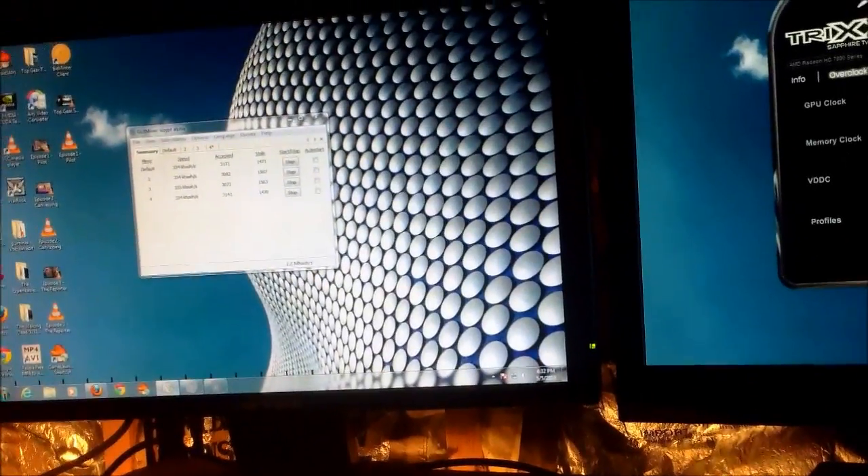I'm running Litecoin mining at this time, and I'm running just under three Litecoins a day — about $10 per day on this rig. Minus power, which is $1.50, so I'm netting about $9.50 on this rig per day. I'm running 600 watts right now, about 5 amps. I direct-wired a plug on a 20-amp breaker. I can expand at least two more machines on this one plug, and then I might use another empty breaker — because you don't want to overload a breaker.